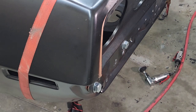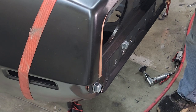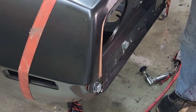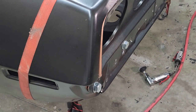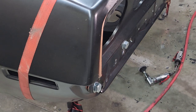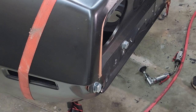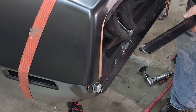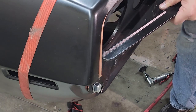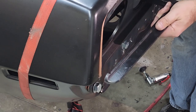Get yourself a big old 12-inch C-clamp from Harbor Freight that's actually spreading apart because it's China. What I did was I ground down the foot of it, and this kind of fits the radius up in there. And look, I've got my little clamps, you should get some more of these. They come in pretty handy for this part. So, one of these, clamp down in here. Shove this in through the taillight hole. And this round part here is going to go up against there. In theory. There.